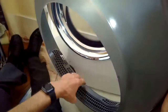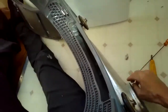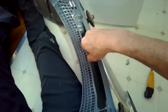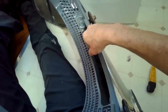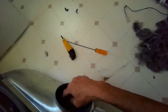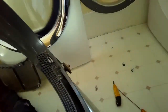Take your time to make sure all those vanes are totally clear. Now I'm pulling out the filter and cleaning this filter housing and ducting because there's a lot of dog fur and lint caught in there that gets pulled into those vanes. I just cleaned all the vanes on the blower wheel, but if I didn't clean this area, as soon as I turn on the dryer new lint would be sucked in and pollute it all over again. With all this increased airflow, this dryer is going to dry fast and be very efficient.